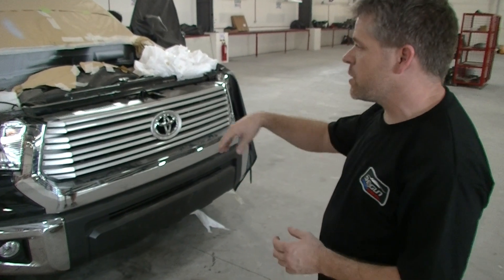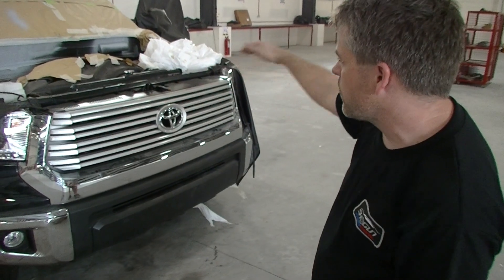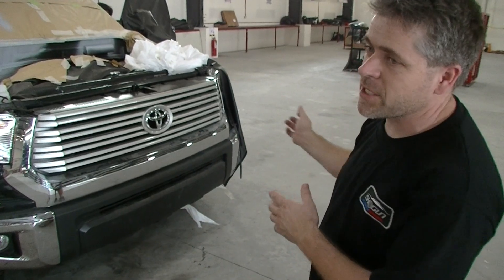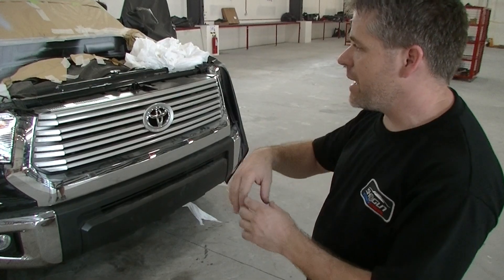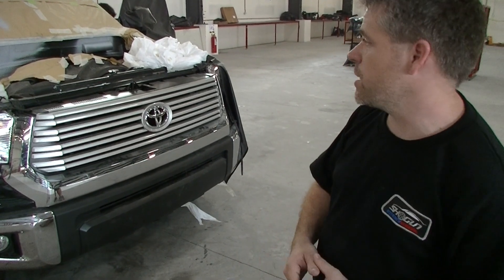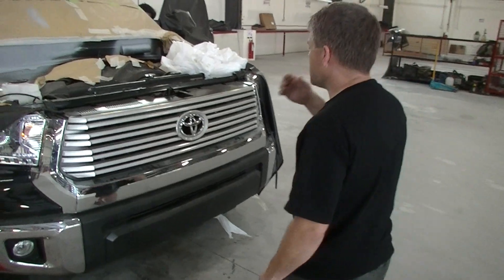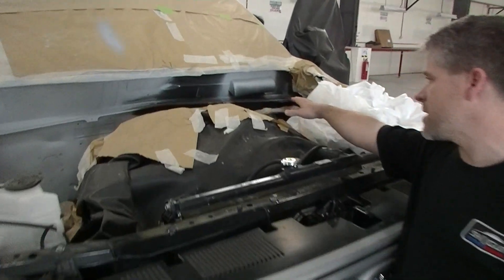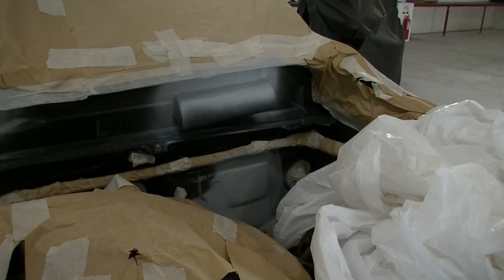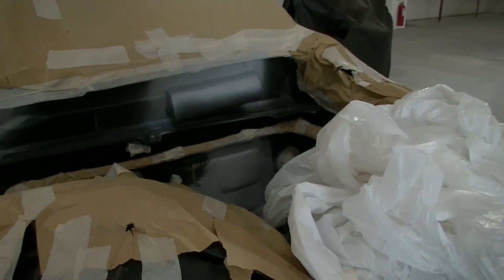What we've actually done at this stage is we've completely remodelled the wiper scuttle on the car — that's been modified and painted. We've now made a new plastic upper wiper scuttle that is in mould production at the moment. We've also got a new fresh air intake on this side here where the air is going to be able to go up and into the new heater box of the vehicle.